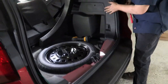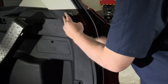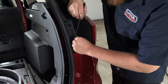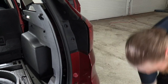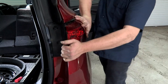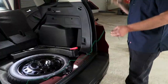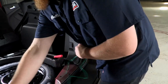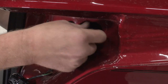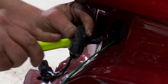Now what we're going to do is go ahead and open up our passenger side and take our tail light off so we can run our wire to the right side. You just want to be careful not to break any alignment tabs or clips that hold the panel in place. Our next step — we're going to go ahead and pull the covers off again, pull the two bolts holding the tail light in place, and then take that off. Now that we have our light off, we're going to do the same thing — disconnect the electrical connector and set our light aside. We're going to go ahead and run the green wire to the passenger side, making sure it gets underneath our panel, coming back behind and out the grommet hole on this side. Then, same as the driver's side, we're going to go ahead and make a slit in our grommet and pass our connector through.